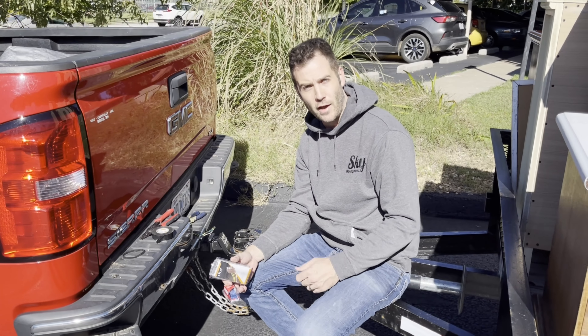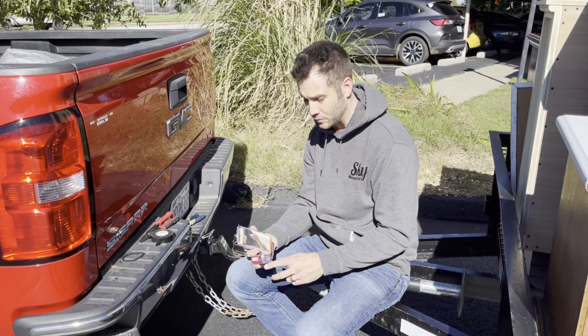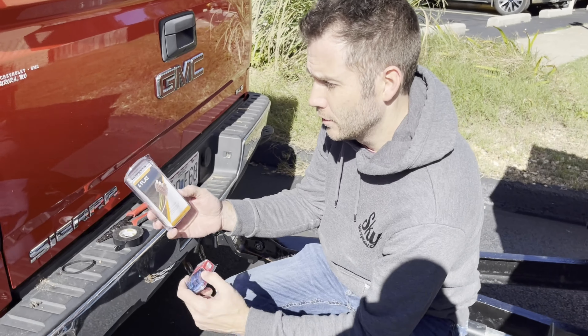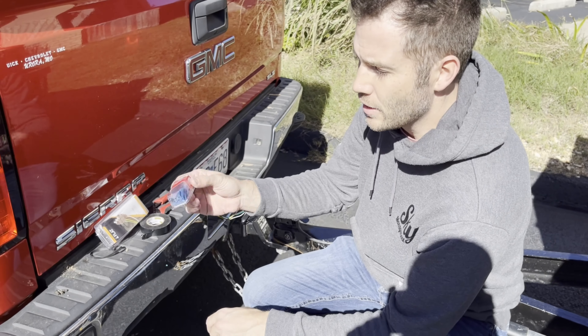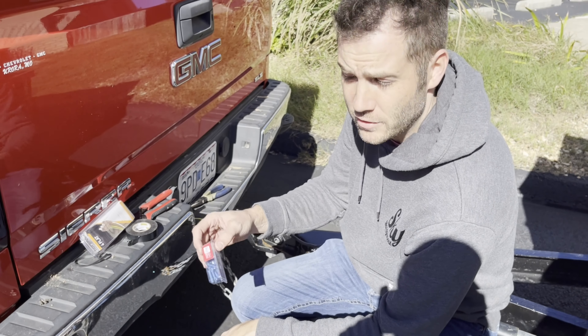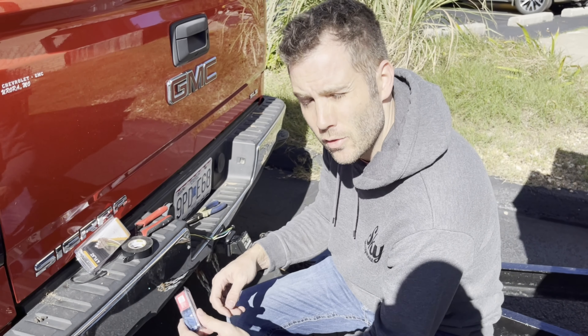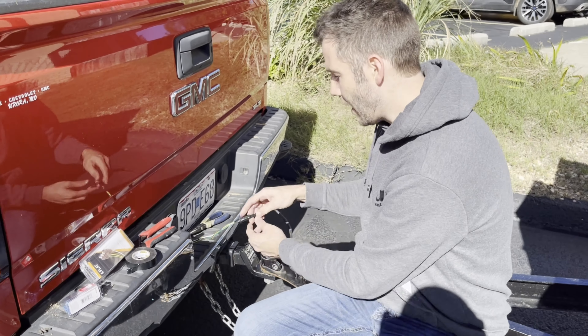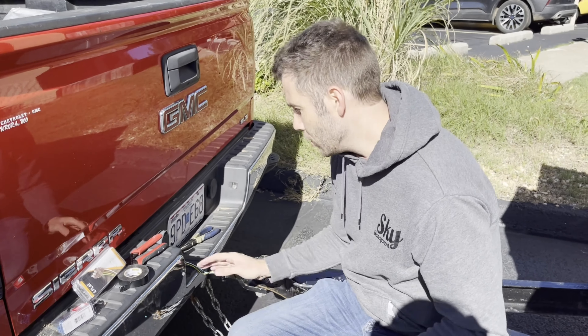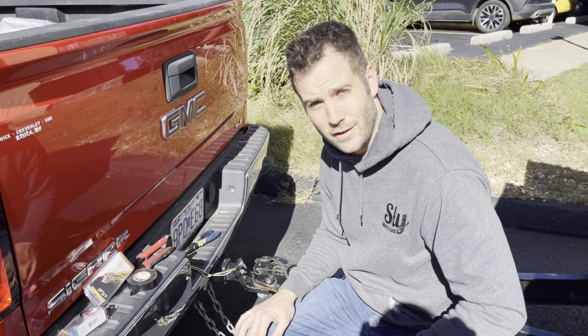Thanks for spending your time with us here — I hope you found this helpful. If you did, definitely like and subscribe. I bought this at O'Reilly's — it was about five dollars for the four-pin flat connector and about three dollars for the butt connectors the right size. There's a whole bunch of them in there so you've got them for other wiring projects too. You can use wire nuts but they can get caught on things; butt connectors are a more straight shot and allow you to wrap it up and keep it all nice and clean. So while you're out there on the road, make sure it works, test it, stay in compliance. Thanks again for watching.